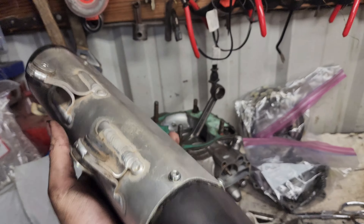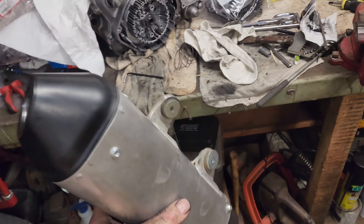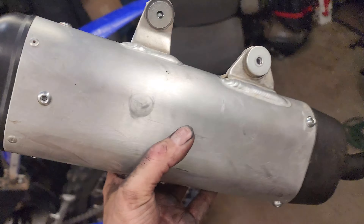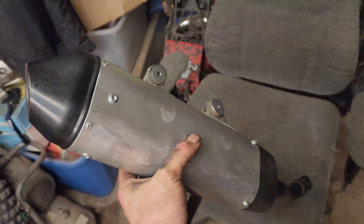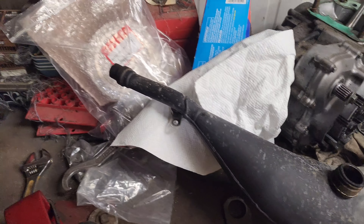All repacked and freshened up. I'm not gonna take the time to polish it up because this is a practice bike and it gets many many hours on it, but old packing out — all nasty packed with caster two-stroke spooge — and in with clean, nice, ready to rock.